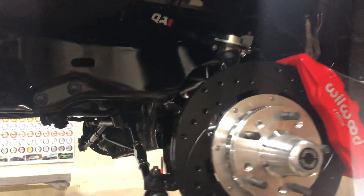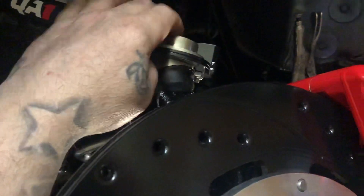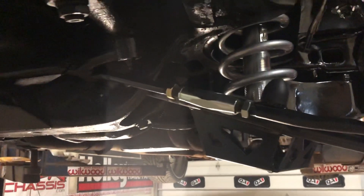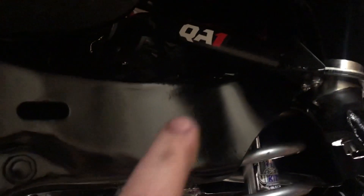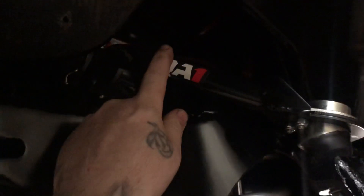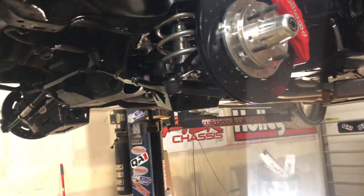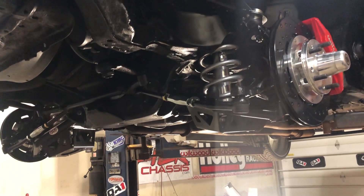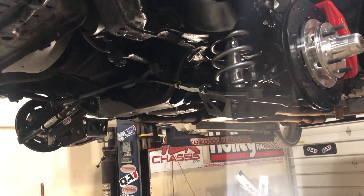When he bought the arms he bought the race ones, which have this style ball joint that you can tighten and loosen at the top and at the bottom — certain tools came with that. I had put a set of links aside for him, but then I realized through all the box of parts he had his own, so I put them on. Rule of thumb with the upper control arms for all you guys — instead of looking at the paperwork, the sticker always goes to the front. For G-bodies and full-size cars, when you're putting the QA1 upper control arm on and you're not sure which way it goes, the sticker always goes to the front of the car. There are plenty of cars out there with the upper control arms on backwards — it gives you a little bit of degree in steering but makes the tire closer to the frame in certain spots. It still works, but it's not correct.